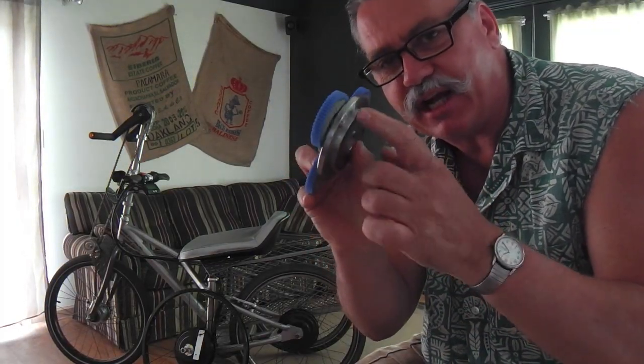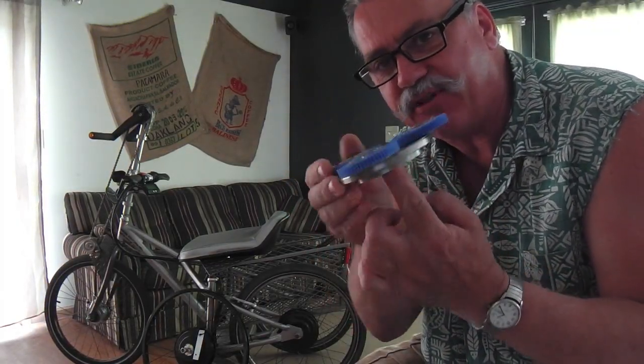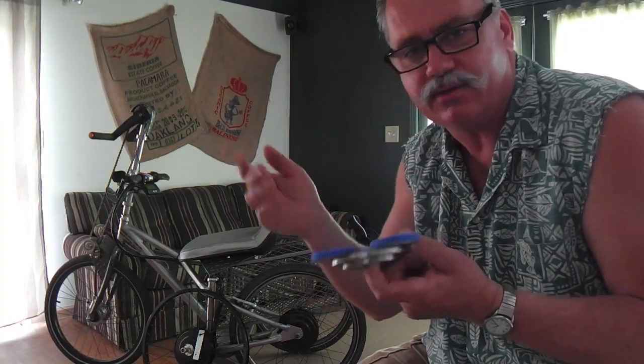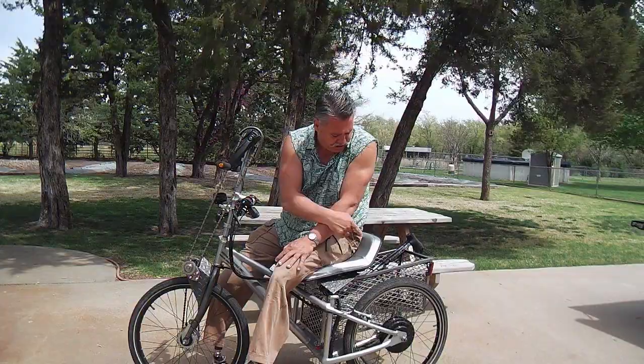The one drawback of the geared hubs is that they have moving parts. Here we are with the parts — this is the planetary gear set, and this is actually the clutch mechanism too. You don't have to buy the whole clutch mechanism; you can just buy these individual gears for about 18 or 20 bucks a piece. That's really the best way to go. I needlessly bought this whole clutch set with all the gears on it because that's all I could source at the time, and I soon found out you can buy these gears individually.